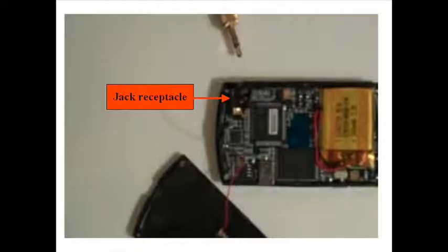You really can't get at the internal mechanism so as to fix it. What you really have to do is have one that has exposed contact points. I'll show you what I mean here. First thing you have to do is open the MP3 player case — you can generally do that with a small screwdriver or a knife edge, getting it in between the two plastic housing pieces and snapping it open.